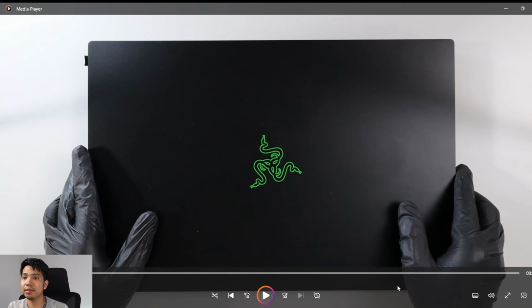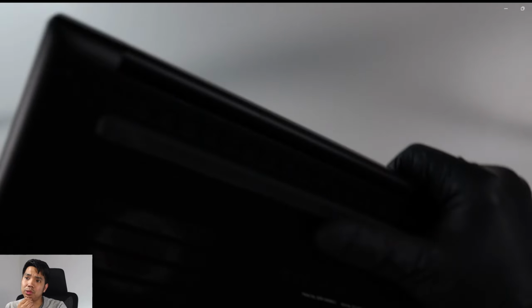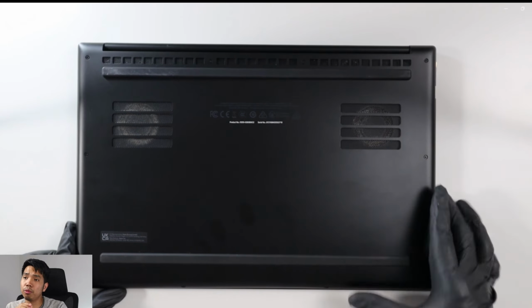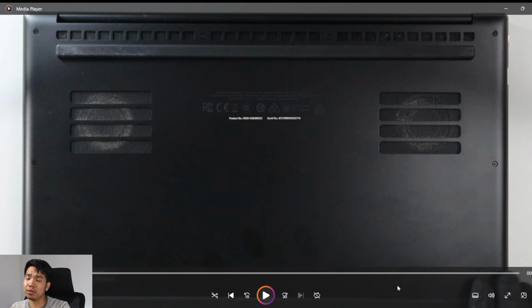Right, so this is my Razer Blade 15 2021 model laptop. As you can see, I only had this for 2 years, so it's pretty new, not used too much, but the dust buildup on the fans is now quite noticeable even from the outside. At this point you can use the soft bristle brush to brush off the ventilation grills, to take off the dust from outside.